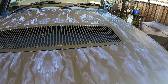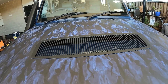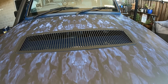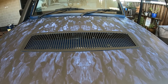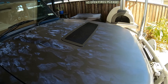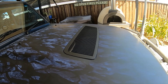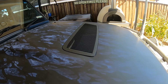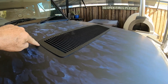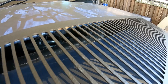I'm not worried about airflow really. It just provides airflow into the engine and also to keep the BCDC charger cool. It was stainless. I replicated it at the same time that I did the grill and the toolbox lids. The instructor manuals say to use silastic — I used construction adhesive because it was fast curing, five minutes. So it was a lot quicker than having to pull the fiberglass bonnet scoop out and clamp it all up. I just held it in place with construction adhesive, and once it was set, happy days. I did get a little bit of glue coming out the sides but I just cleaned that up — you can see just a little bit of it in there.